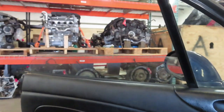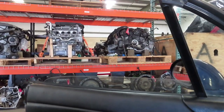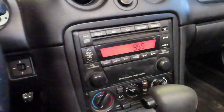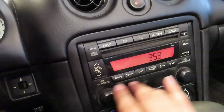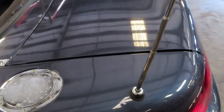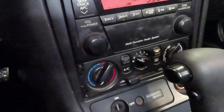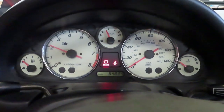Now to the fun part — let's see if everything works. There's not a lot of electronics on this car, but there are some things to check. First, the power windows: if they're slow that's pretty normal, but they should work correctly. These window regulators, especially the driver's side, go bad very often — in this case both look good. The radio display, volume knobs, and CD player aren't the most reliable but actually look okay here. When we turn the radio on we're looking at the power antenna — it's supposed to extend to about six sections and this one definitely does not work correctly.